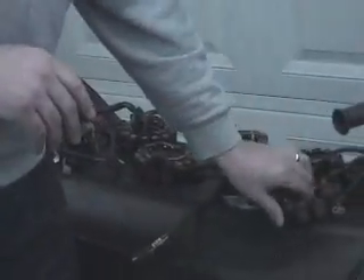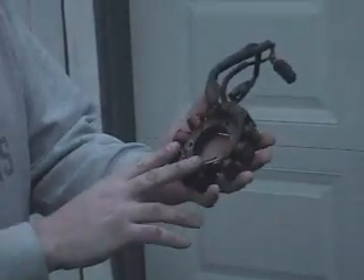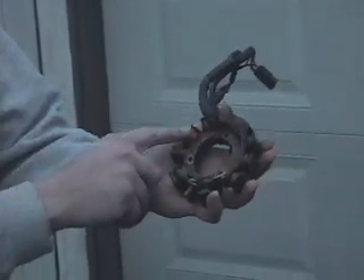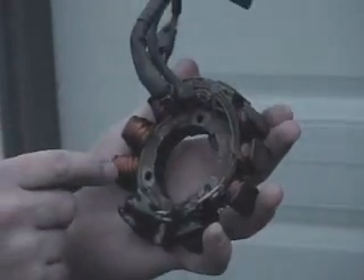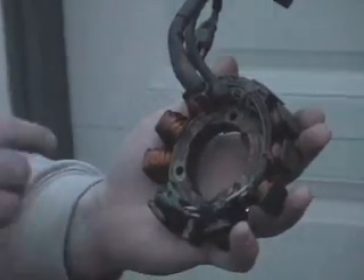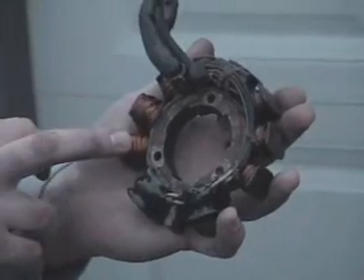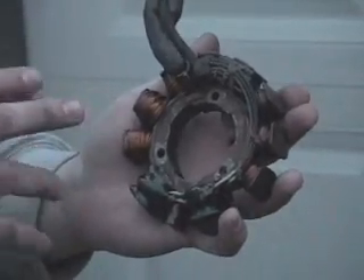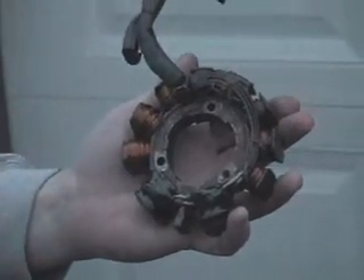First I'll start off with the stators. I've got a bunch of stators here just to give you an idea. This is a mid-90s, early-90s EFI Arctic Cat stator. We've got a couple ignition coils on it, but all of these other coils wound on these posts have much larger gauge wire, and this is the power side for your stator. As I show you the other stators, you'll notice every single stator has much larger gauge wire — that's the AC power that powers lights, hand warmers, gauges, and so forth.